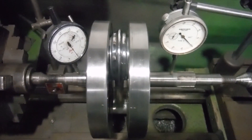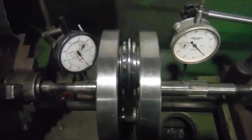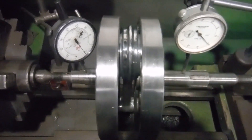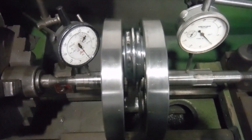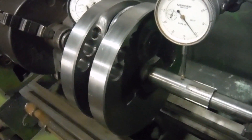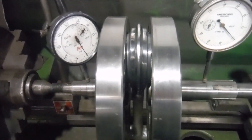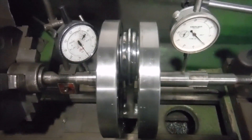I've got here the crankshaft for the Royal Enfield 500 Bullet that will be known as ASBO number 46. I've already filmed a before video of this crankshaft before I dismantled it, and it was one of the rare exceptions where to all intents and purposes there was absolutely no run out at all — there wasn't even barely a twitch on either of the needles. I commented that it might be a tough act to follow, but I've done my best. I've lightened and rebalanced the flywheels, polished the conrod, fitted a new crank pin and a new floating bush. The hard eye in the conrod was perfect, so it's all gone back together and I've been truing it.